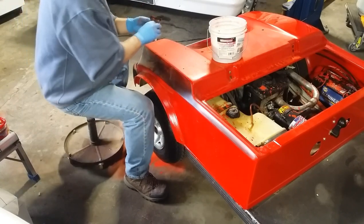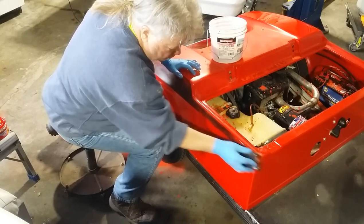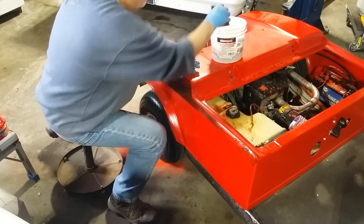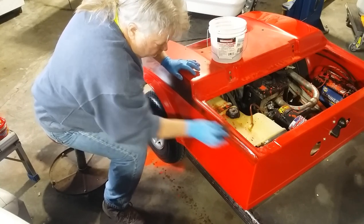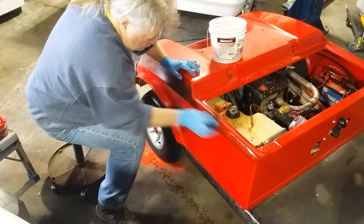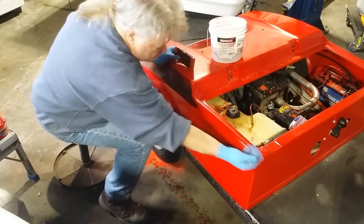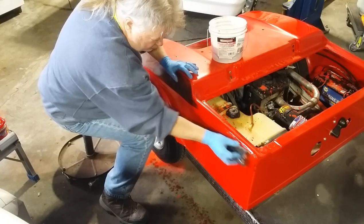Go after this black stripe. I've got a rubber pad on it. Don't go after it without a rubber pad. You'll be digging holes. Caution around your corners and edges, right? You'll blow through those really quickly. But we're just trying to get the stripe off completely with 500 grit, and then we'll go to 1,000 grit after the stripe is gone. Working on the stubborn areas.